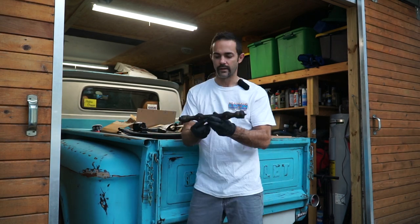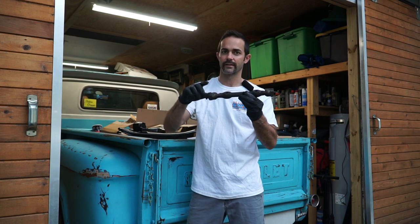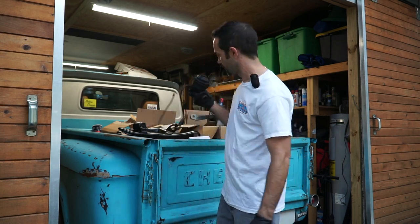Everybody's favorite treat is a ball joint. During the whole process of filming I actually grew a mustache — apparently if you're doing a spring swap, a mustache just grows out of nowhere, and I'm okay with that. These upper control arm bushings have a lot of slop in them — they're going bye-bye. And last but not least, this truck is getting a dual master cylinder with a brake booster. Diesels don't create vacuum because vacuum comes from the Venturi on your carburetors, and diesels don't have carburetors, distributors, spark plugs, or spark plug wires. They're awesome. We even painted the control arms — didn't really prep them well, but who sees these on this old truck.